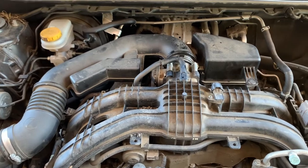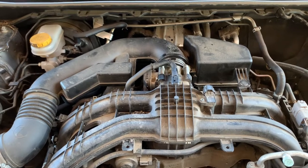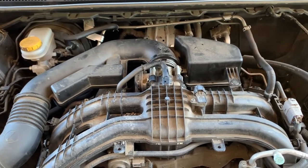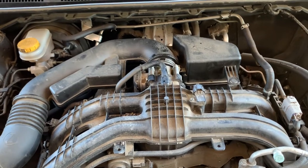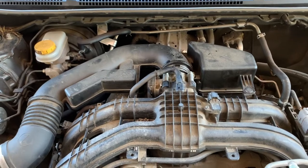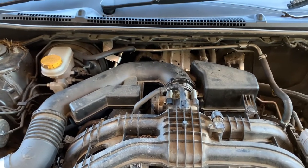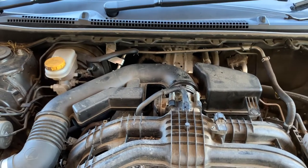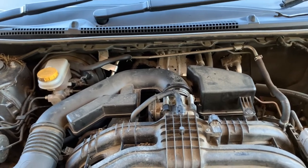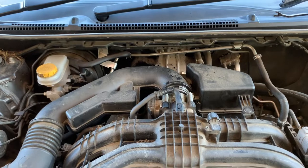One thing you need to know is that after you spray this inside the engine, it will take a while to start and it will run rough for a little bit. It'll also blow white smoke and have a funny smell — that's completely normal, that's just burning everything through. This has been sitting for about five to ten minutes, so I'm going to start it up. You'll see it takes a while to start and runs a bit rough. You just let it run, it'll clear through, and in the end give it some hard revs to clear everything right through.